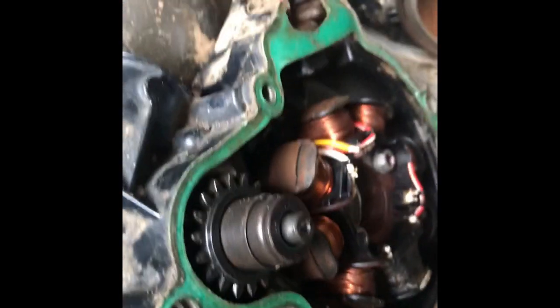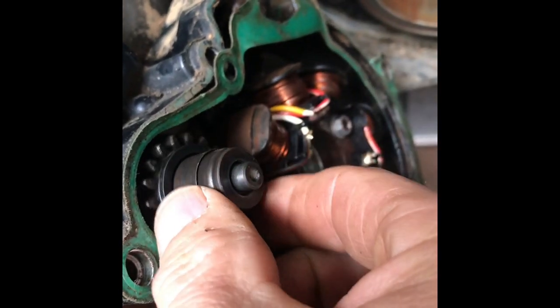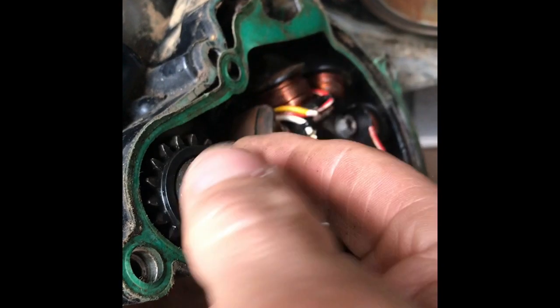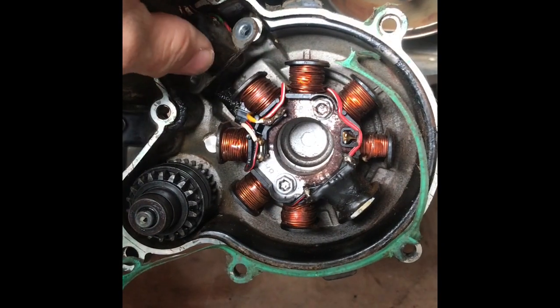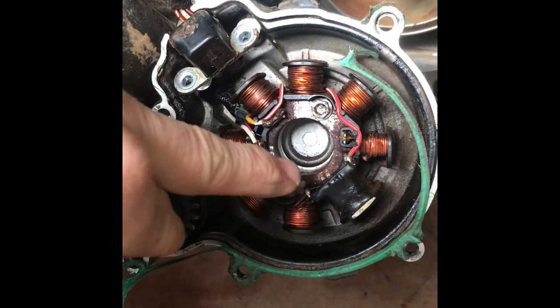After researching, these are basically not very good. They've brought out a better one with a slightly different number of teeth in the gear ratio, so you have to replace this and the crown wheel behind it. To show you all that I'll have to take this inside. You need a 6mm socket for those — I've taken one off and I'm going to do these two as well.